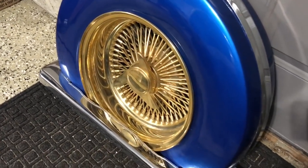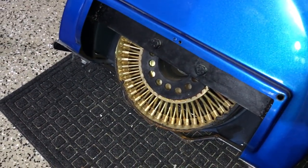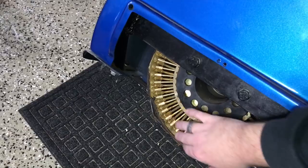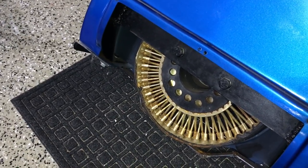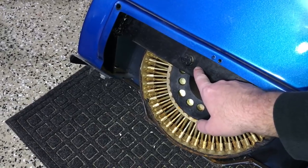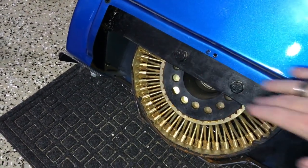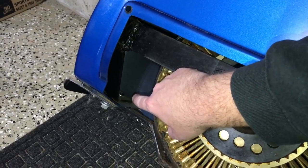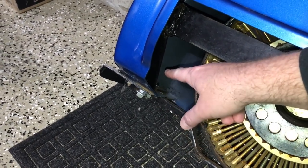Let's show you what's going on in the back. Here's the kit from the back — you don't see it because it's so close to the vehicle. One of the first things you'll notice is that the entire bead of the rim was cut off with a sawzall, right to the nipples on the spokes, to give enough room. I took the adapter, lined it up with this piece of steel, and welded lug nuts on the other side so the rim just holds in with these two bolts. I also welded and made brackets — one across, one down, one there — to stabilize the rim.